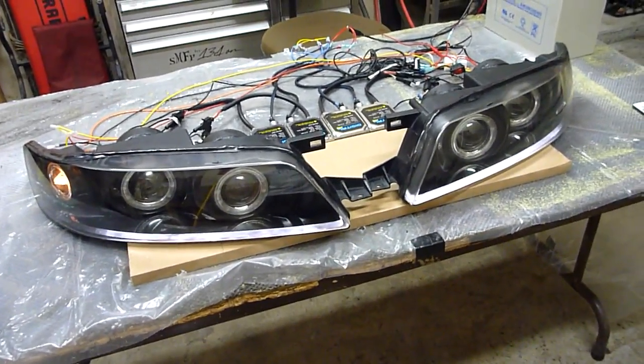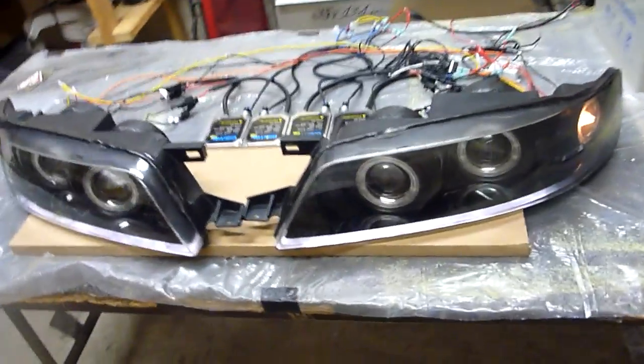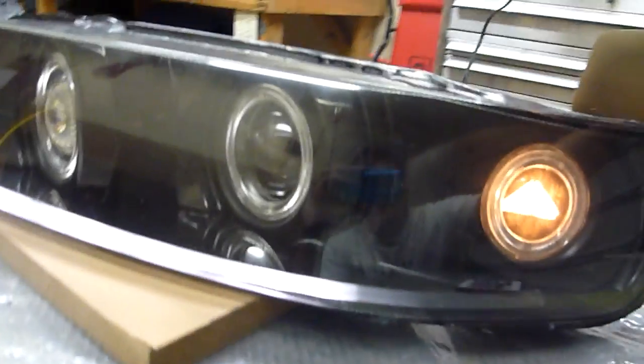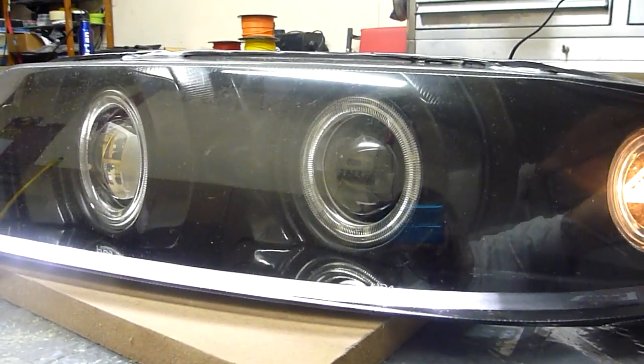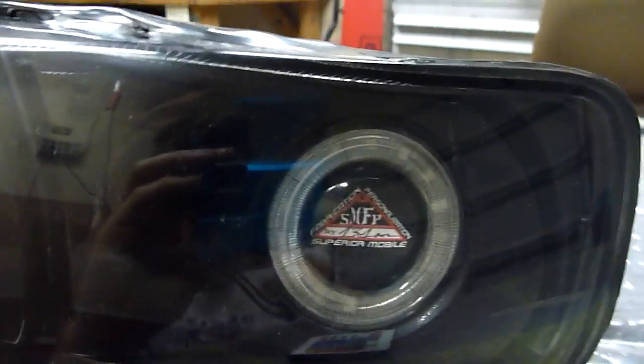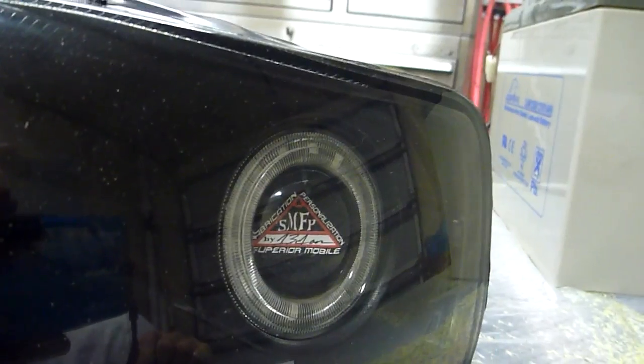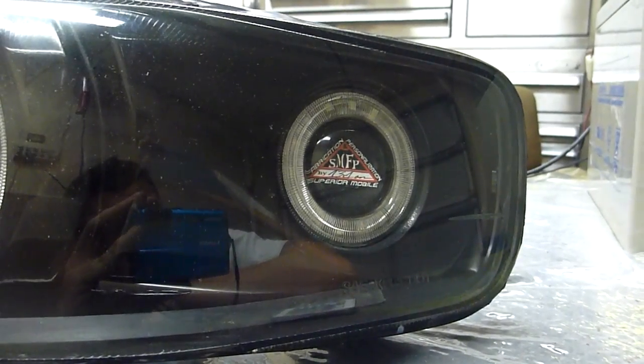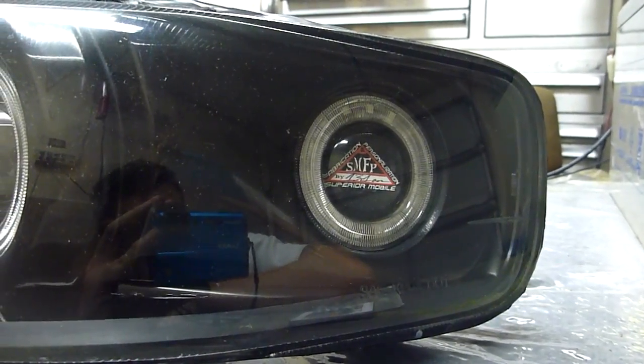And you're like, all right, so how does this whole thing work? Okay, well, since we have a blinker built into there, I'll show you the blinker. I wanted a constant theme of having this projector lens surrounded by that halo. So I actually created this piece right here. I don't know if you can really tell from the video, but I definitely recommend you look at the build pictures. Out of a solid piece of acrylic, I routed that out and made it nice and smooth and shiny.